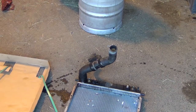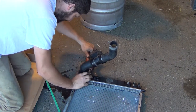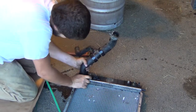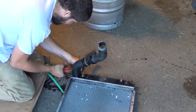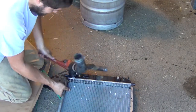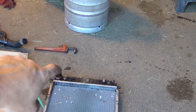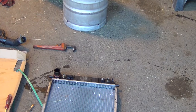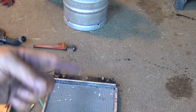That will not spin. After fiddling around with it I got a smaller pipe wrench. There's a line and I'm guessing that line has to go all the way back where you bent the tab. What ended up happening - I spun it around to that white line that was over at the tab, put my foot really gently on the radiator right there, and I lifted it up and she pulled right off. It's a locking connector - it's got four grooves, slides on and locks down at 45 degrees. Then you bend that tab to keep it from rotating out and blowing off.